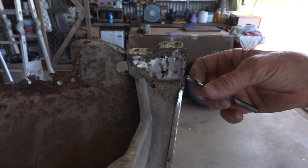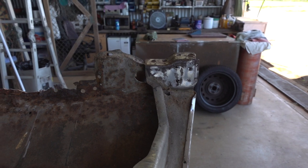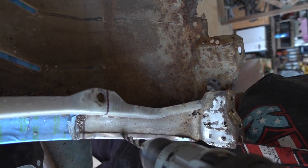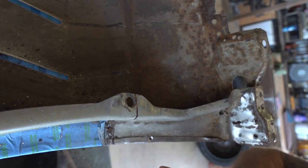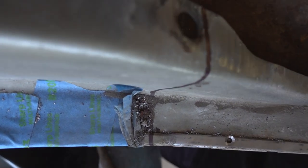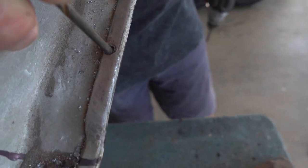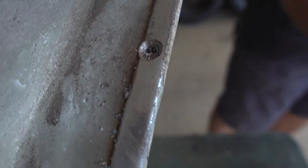Now we're going to use the big drill to hollow that out. It's a kind of flat-angled drill — you don't want it to be too sharp an angle, otherwise it drills through too quick. You just want to take the metal from the top. Stop-start is a help as well. Take your time, pull the drill off and have a look. You can actually see whether you're through the first section of metal — there's a line at the bottom where the second part of the steel starts to separate from the first. That's as far as you need to go.